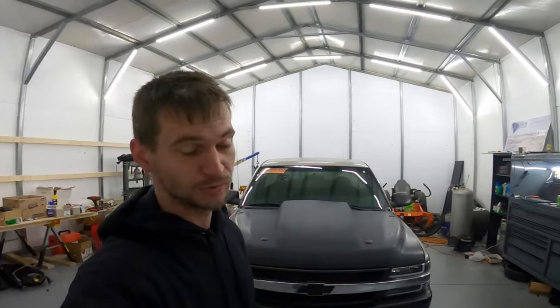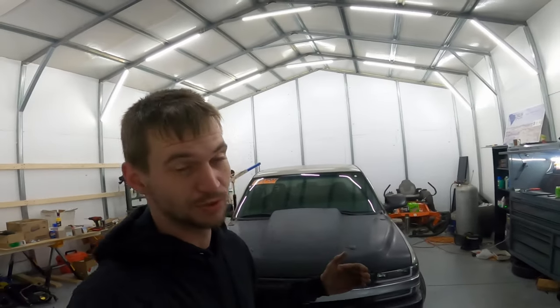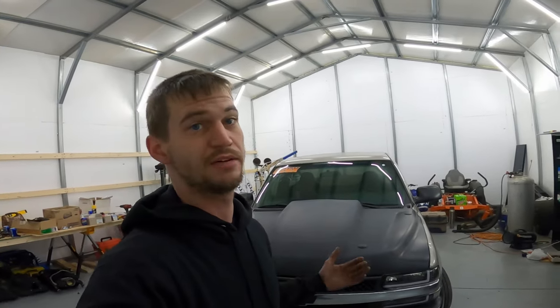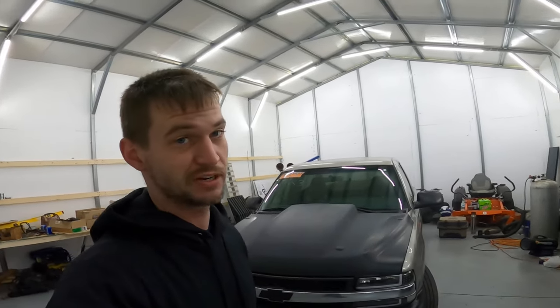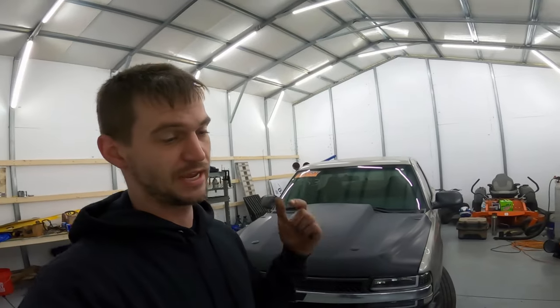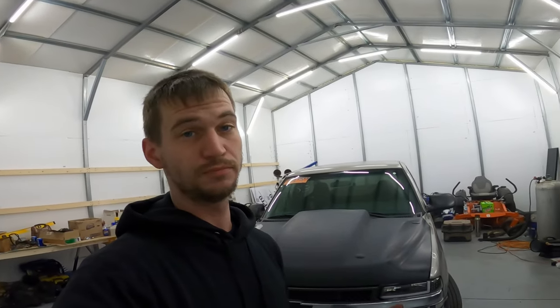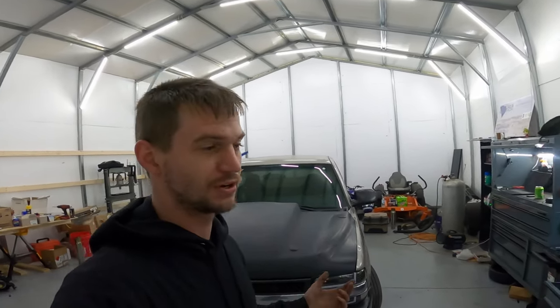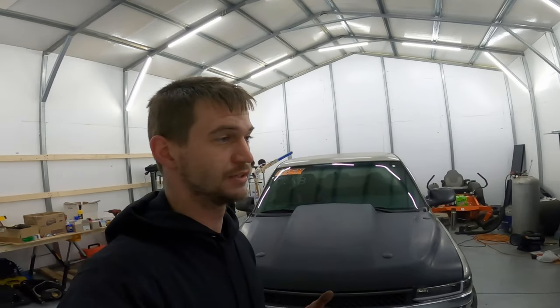I fought with wiring on this. I ordered one of them cheap Amazon harnesses and I've had to repin almost half of it, so I'm not gonna recommend that harness for you. They have number 5 and 4 coil pinned backwards. So when they're trying to fire the opposite coil they're supposed to, that was causing little backfires through the exhaust, obviously, because it would be on the exhaust stroke and it'd fire the coil since it was firing the wrong one.